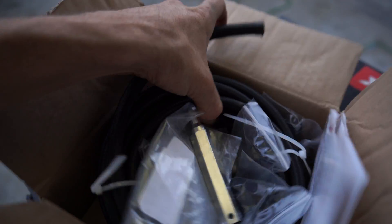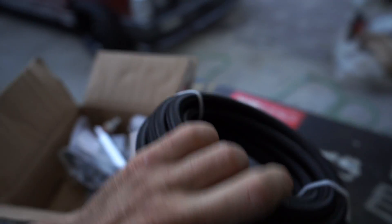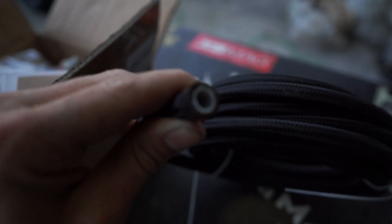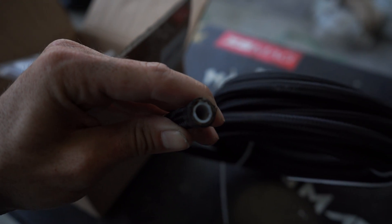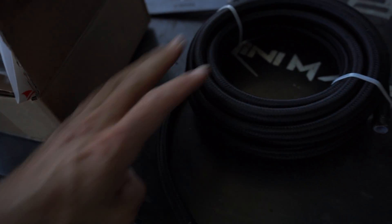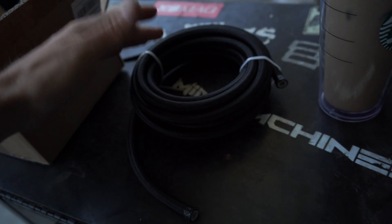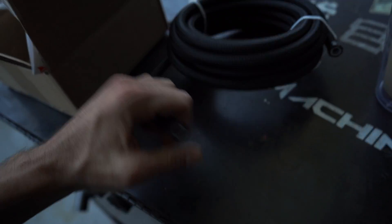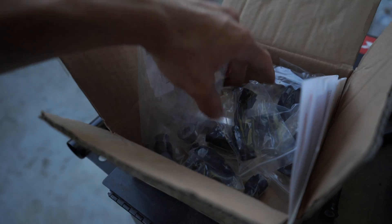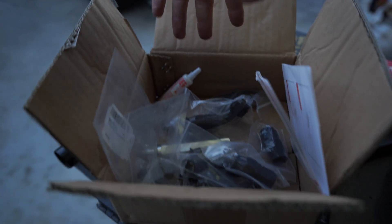So this is what we're waiting on — these are the hoses. You can't just buy any ordinary 6AN hose. You need to buy PTFE. You can see the nylon inside of there — the nylon is actually for high pressure. This is rated at 3,000 PSI or somewhere around there, but it's more than enough for the power steering system. This kit actually comes with eight different AN fittings.